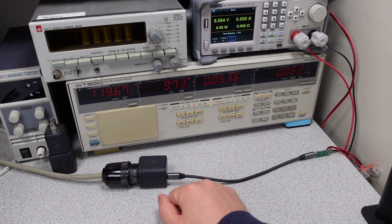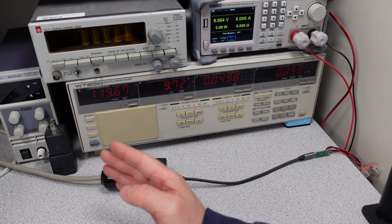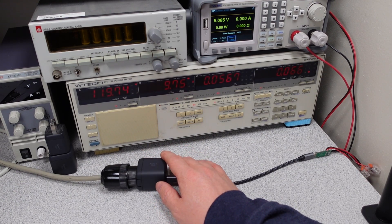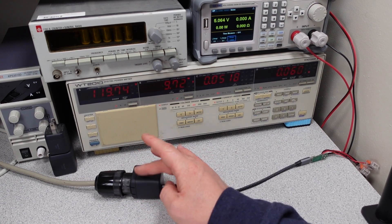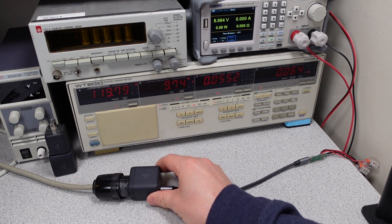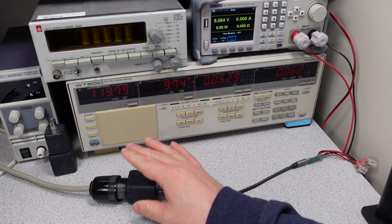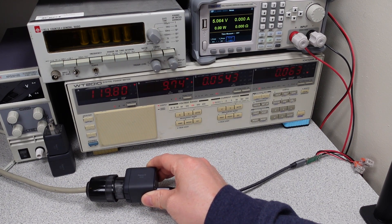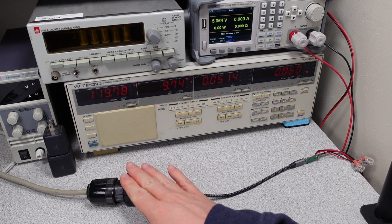Overall, looking at this power adapter, it's okay — similar to the other Anker adapter. It's a solid adapter, better than cheap garbage, but it's not the top of the stack. No power factor correction, and it falls in line with the other power adapters available. The issue I have is that it falls pretty far short of the Amazon Basics 65 watt adapter, and that's a problem because this adapter is almost $60 — a premium-priced product. In terms of power quality, I expected a little more and was a little disappointed by this one.